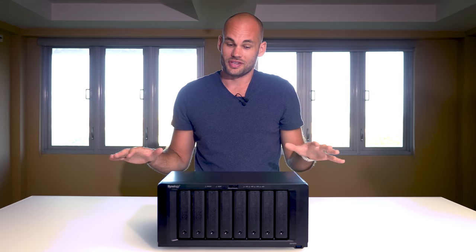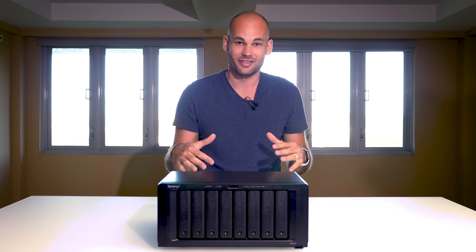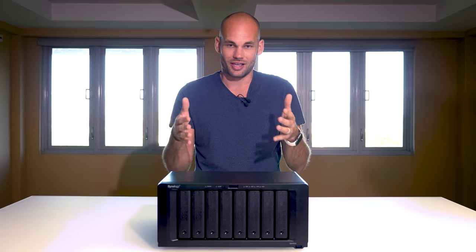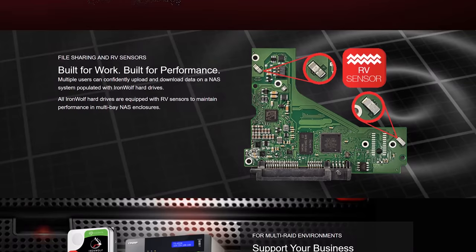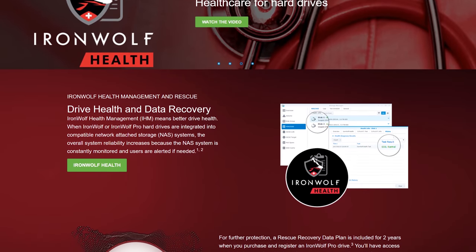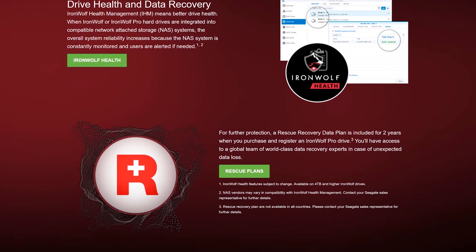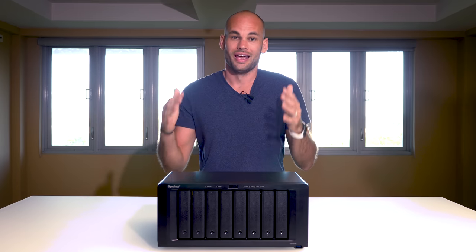Not all hard drives are the same. If you put a hard drive in something like this with eight drives side by side and multiple computers connecting to it, there's a good chance it's going to be spinning 24 hours a day for its entire life. There are specific hard drives made with NAS devices like this in mind. The IronWolf drives are specifically made to run 24/7. They also have software that works directly with the Synology that can tell if something is going wrong with the drive before it actually fails — it can warn you to replace the drive in advance. Seagate also has a three-year warranty and a two-year data recovery plan, covering drive failure, fire, flooding, or anything else.